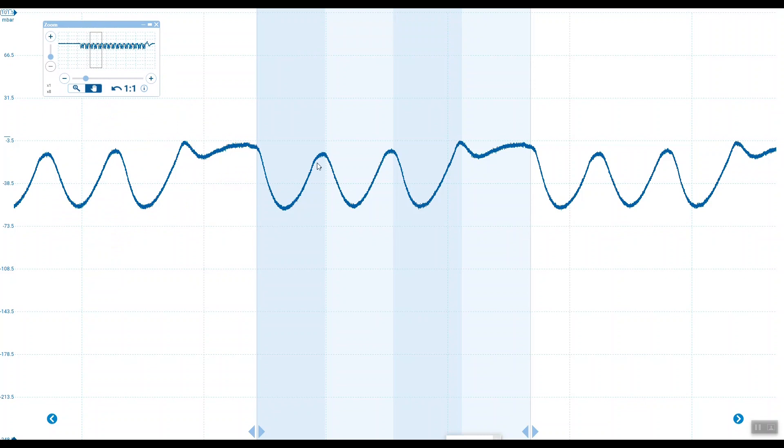We've got an inlet manifold pull there, a pull here, and a pull there — and now here we are missing a pull event. It's almost like we start to pull down here and then we don't quite make it, because at that point on the intake manifold we've got an intake stroke but with no seal within the manifold, so we can't pull this negative pressure. And then of course the pattern repeats. The key here always is looking for uniformity within the waveform.